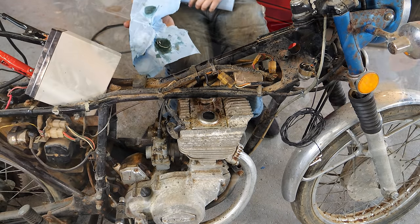All right, one last repair before we put our tank on the bike, because you can see right there is a little hole that I found when I was cleaning. And there's a couple other questionable spots along this seam as well. So I'm going to get some epoxy in there and seal that down. Once again, can't use RTV. The gasoline will eat right through any RTV. What we need to use here is a two-part epoxy, such as JB Weld or any clear hardening epoxy.